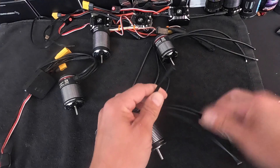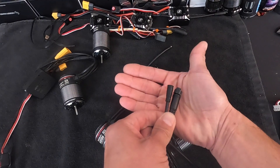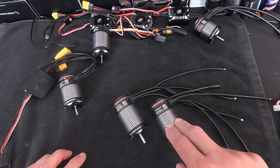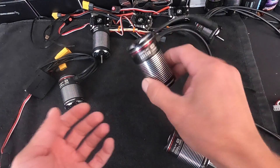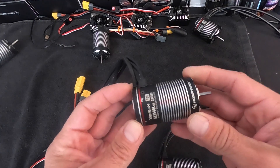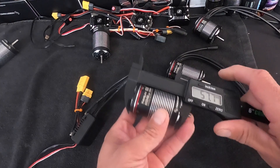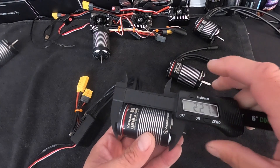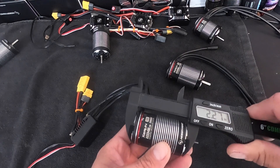What I'm excited about is these new sensor harnesses. The old ones are pretty big and clunky — there's a pretty significant size difference between the two. The new R2 will only be available in the 3300 kV in the 550 size, because with a 2800 kV 540L there wasn't really a need for the 550 at 2700 kV. The 540L measures about 57-58mm in length, or about 2.3 inches.